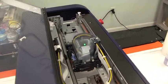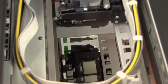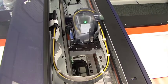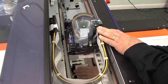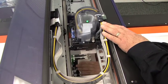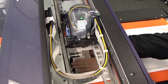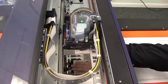We're going to use that mirror to look into and see the printhead — it's a lot easier than trying to bend down and look underneath the cover to visually see the printhead. We now take our treated facial wipe, paper towel, or rag and put it up against the printhead. We never wipe the printhead. We're going to apply some upward pressure and gently wiggle our fingers forward and backward a little bit. We want that to remain in contact with the printhead for about 5 to 10 minutes.